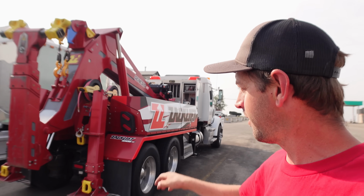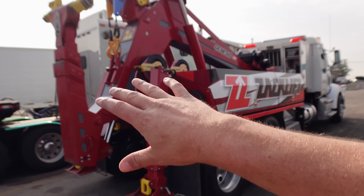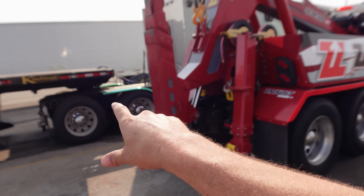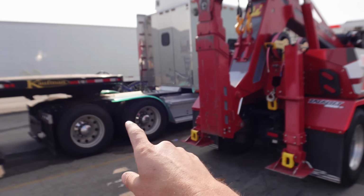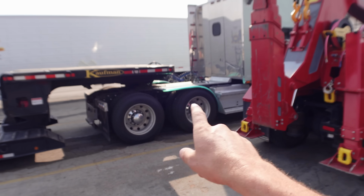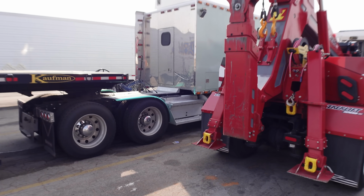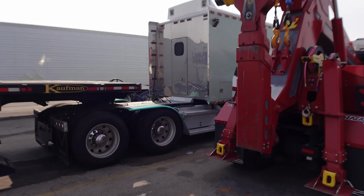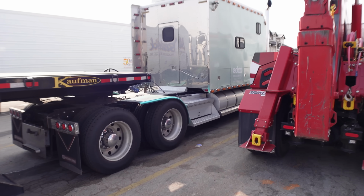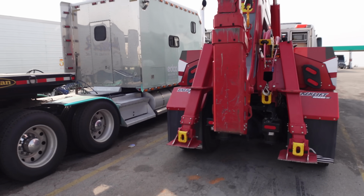I mean, you can put a Zacklift on the back of that, and for long haul type of towing stuff, like what I'm doing on this trip, you wouldn't have the whole boom, and the Genesis wouldn't fit because you only have that little bit of frame right there. But the Zacklift fifth wheeler, that's just the underreach off the back that folds up right there, that would absolutely fit. And you could even have the single winch on the top, have your underreach, could have the stiff legs, you just wouldn't have the big recovery boom off the top. And that would make one hell of a comfy long haul tow rig, especially with that long wheelbase. It'd be great for towing.